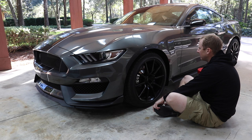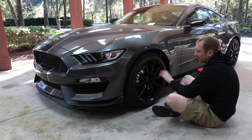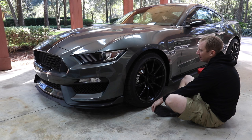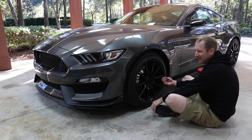Would I have purchased it if it was an option for $5,000 more than this? Then, yeah, I probably would have. I would have hated the red stitching inside. But anyway, the front end, the simple difference is that we have red brakes, different, slightly stiffer springs, which you could easily swap out. Which I'm going to end up doing some aftermarket spring on the magnetic shock anyway, and then wider wheels and tires, which I always have a tendency to prefer slightly narrower fronts so that I don't get a lot of tram lining and the steering doesn't feel heavy.